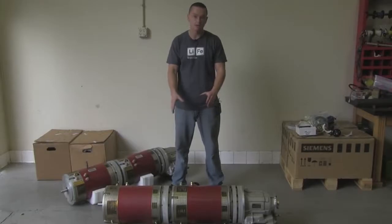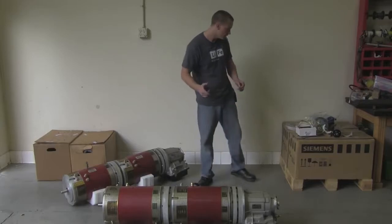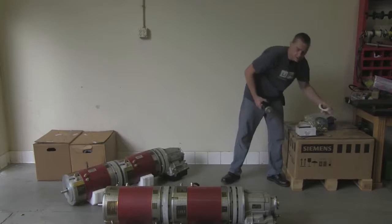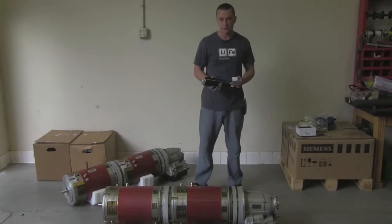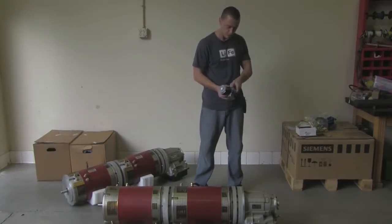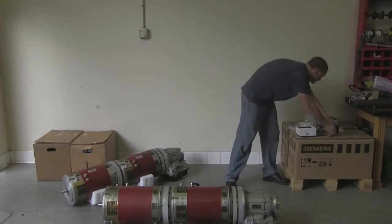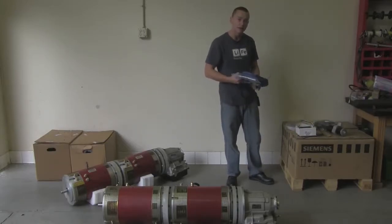We have the two motors bolted together now and the PowerGlide bolted to the last motor. We should talk a little about the hydraulic system. We don't run a torque converter, so when the motors are not turning we have to supply hydraulic pressure with this pump to keep the clutches engaged. It comes with good mounts and a rubber perch to keep it quiet. We also supply fittings, hose, relays, wiring — everything you need. We recommend using number six fittings for running the plumbing.